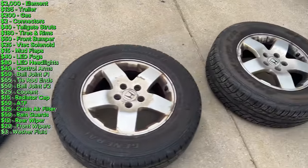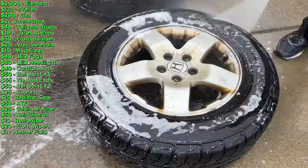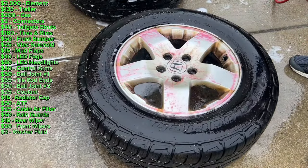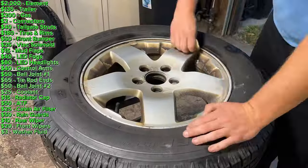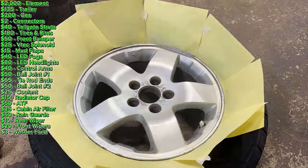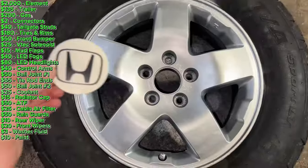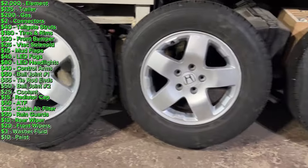Before I put the new tires on that I got from the junkyard, I had to clean them up a little bit. I used my drill brush, pressure washer, and some car wash soap, but that really didn't get them that clean. The brake dust was literally baked into the clear coat and into the paint of the rims. I tried some red wheel cleaner — it helped a little bit but the wheels were still corroded and dirty-looking, so I ended up painting them. I started by sanding all of them down the best I could — my hands were in a lot of pain doing this. Then I sectioned off the rims from the tires with some scrap paper and started spray painting. I used about two cans of spray paint, three coats per rim, about five bucks a can. I lined up the center cap so the H is lined up with the valve stem just as it was from the factory, and before I knew it they looked brand new.